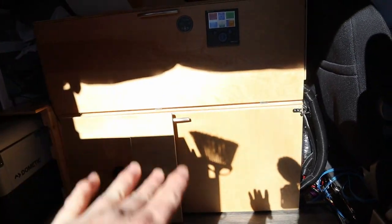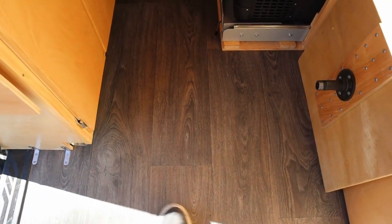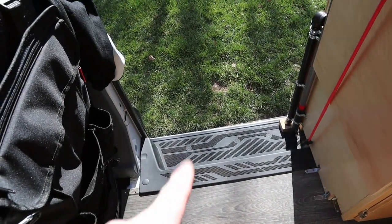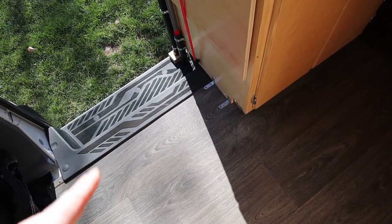I can put new flooring back down, or put the same floor back down if I can save it, versus taking all of the battery boxes out, the fridge out, and all the other stuff out — because that is just more of a nightmare. And if I take all of that stuff out and find out I still don't have the proper spacing for the seat brackets, that's going to be a job for not. So that means removing our sink cabinet, removing our floor edging, and then taking our skill saw to make at least a half-inch deep cut across here — that'll get us through the plywood.